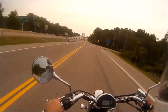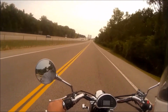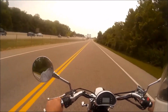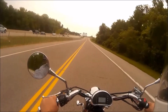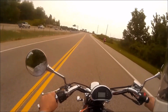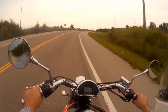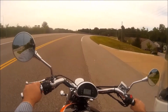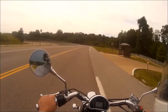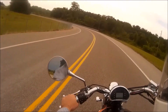I machined a flange on a lathe that I have, and put the correct bolt circle into it, and I cut the angled pipe on the Ducati stock muffler system and just adapted it to fit the bike. Those bikes had a pretty throaty sound, and they're, I guess, an L twin. It's still a V-style twin bike like this is.